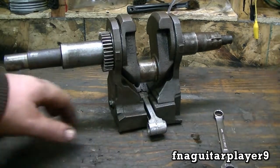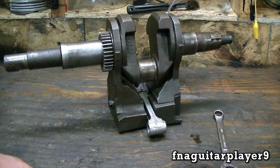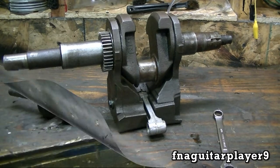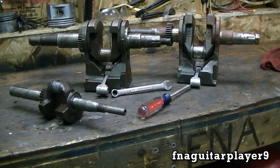Your stock cast iron flywheel can explode at higher RPMs due to a crack in it - like from somebody hammering to get it off. Sometimes they get a crack in there and they can explode at high RPM, and that can kill you. So always run a billet aluminum flywheel if you're taking the governor off your engine. Thanks for watching guys - if you've got any questions about crankshafts let me know and I'll try to help you out. We'll catch you on the next video.